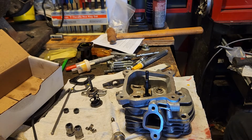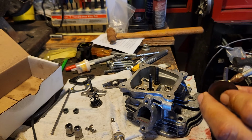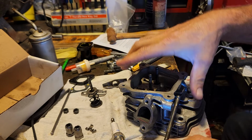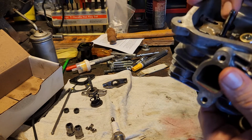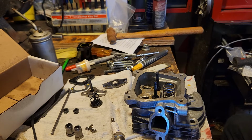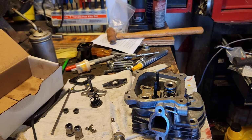All right. Valve's nice and clean. You can put a little bit of lube. I wouldn't really use that thick, goopy assembly lube because it's just going to gum up your intake. But a little bit of oil is not bad. Everybody likes lube. Anyway, so let's put that up in there through the oil seal. Okay. And then we've got to put that on. So you see quite a bit of difference there. That is much higher. I do have a valve spring compressor, which I think I'm going to get just for ease of doing it on camera.